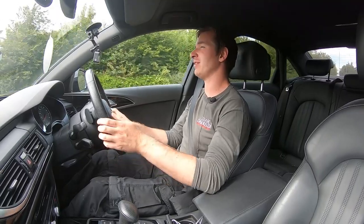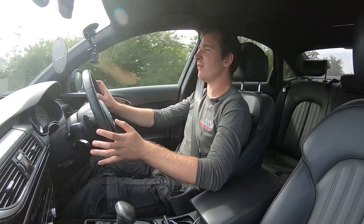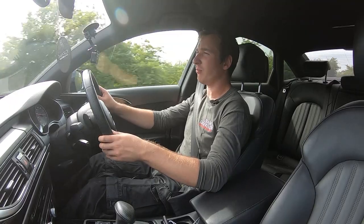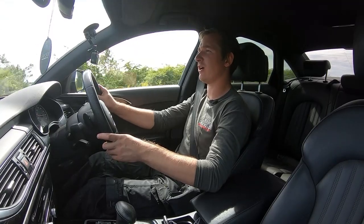We're out in the A6 with the big brakes on. The true test of big brakes is not my road driving — it's Scott's, and he does know how to make the brakes misbehave. In theory, the pedal on this should be a little bit longer because we've got more pistons, more surface area, and we haven't changed the master cylinder. It does feel a little bit spongier, but I'd need to be sure how much bleeding has been done. Sometimes, especially if the ABS hasn't been actuated, you end up needing to bleed them a second time — especially with such big calipers where air traps all over the place, and a little drive normally agitates it.